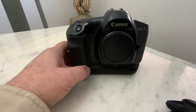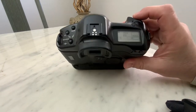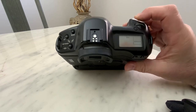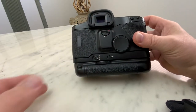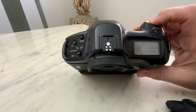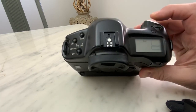Here's an EOS One that doesn't get used much, and when you hit the shutter you get the BC error. You can just reset it by turning off the camera and trying it again — BC error. Oh, there we go, it comes back anyways.